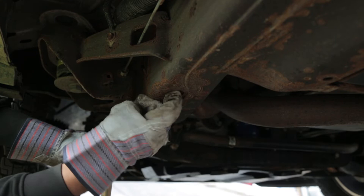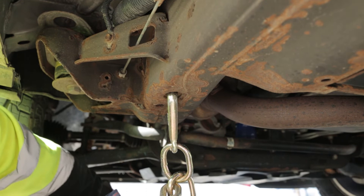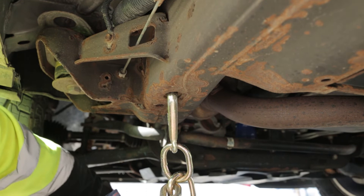But in this case the frame is solid — both layers of steel are solid. I put my mini J right in that slot. It keeps my bridle away from the bottom of the chassis and it clears the front clip. That's why I always use these as opposed to these.